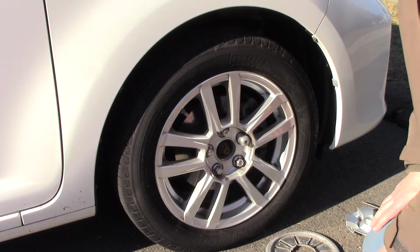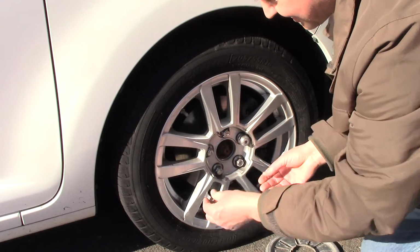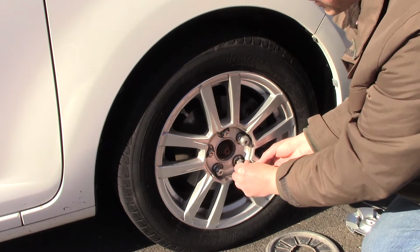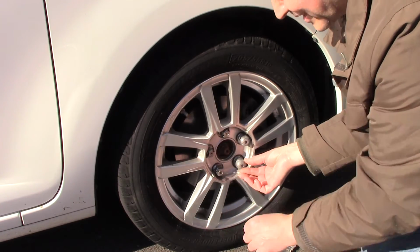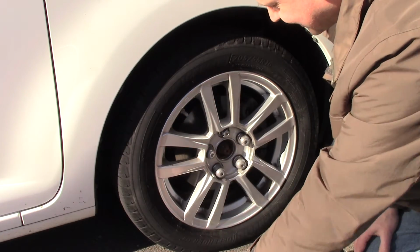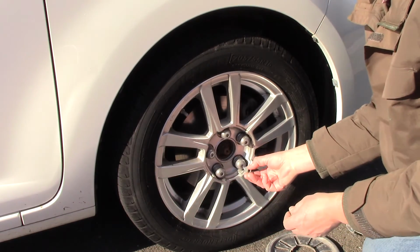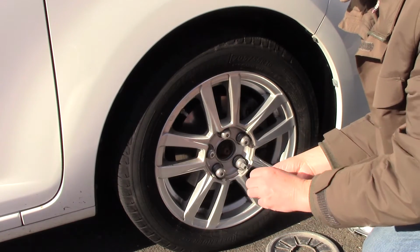So now we're going to install the rest of the fixed clips. And so these clips just slide onto each nut. And as I said, I believe these are 21 millimeter lug nuts on this particular car. Your car may vary. The people who make spider spikes, when you buy a kit from them, they'll know what you need. I ended up buying this set of spider spikes on eBay, so they came with the wrong hardware, so I had to end up buying all new hardware. So those are in, and then this particular car uses the short spacer, which I'll put on here.